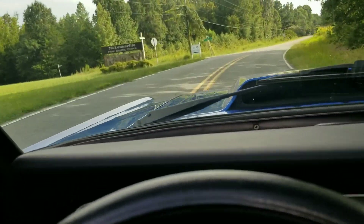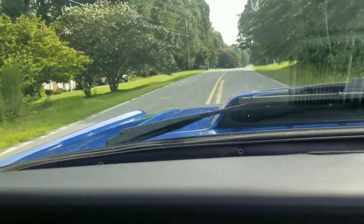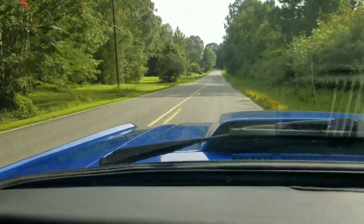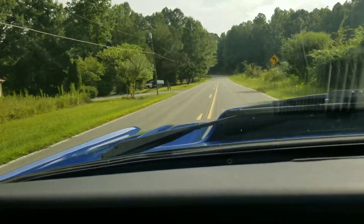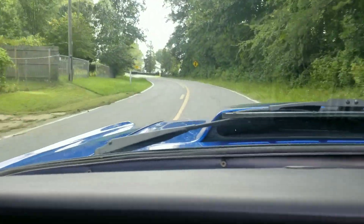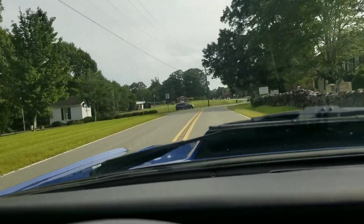It's basically a 306, done on a budget. A lot of the stuff I got from a U-Pull-It junkyard — I'm not a rich guy, so I try to make things work with what I can. It's got a stock cam in it, Edelbrock Performer heads that I ported, an Explorer intake and a rear end I got at the U-Pull-It out of an Explorer. I put it in stock length, which got me disc brakes, a Posi, and 373 gears at the time, which I switched to 355s.